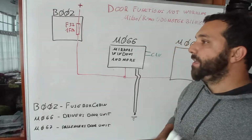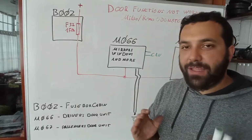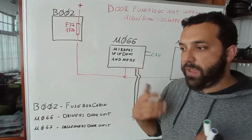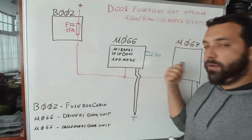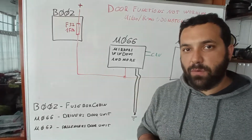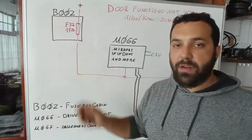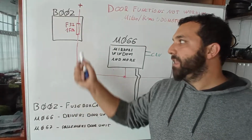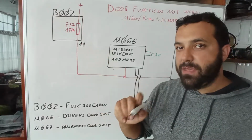Okay, very good. Now it's time to see the basics. And what are the basics for every electrical component? An electrical control unit has to have at least one positive and one negative. For both of these ones, it just needs one positive, but it has several negatives, okay? Like I explained here on the channel so many other times, you have a power wire from the exit of the B002. The description is down over here, okay? And this comes out through number 11 of the V socket.